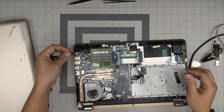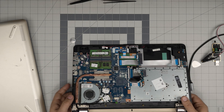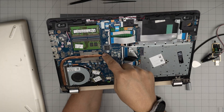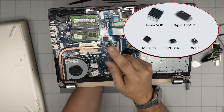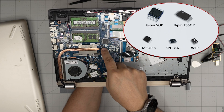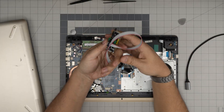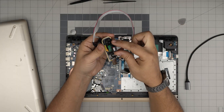Now we get to the second part. We're going to unplug everything and look on the motherboard - every motherboard has a BIOS chip. On this one it's right here. It should be an 8-pin chip, four by four pins, and it should say 'Winbond' on top. I'll leave links and pictures for every BIOS chip type that exists. Once you locate your BIOS chip, you want to grab the BIOS programmer and its probe.